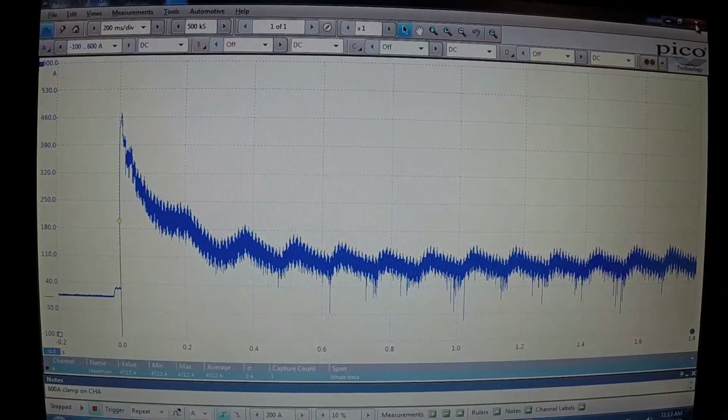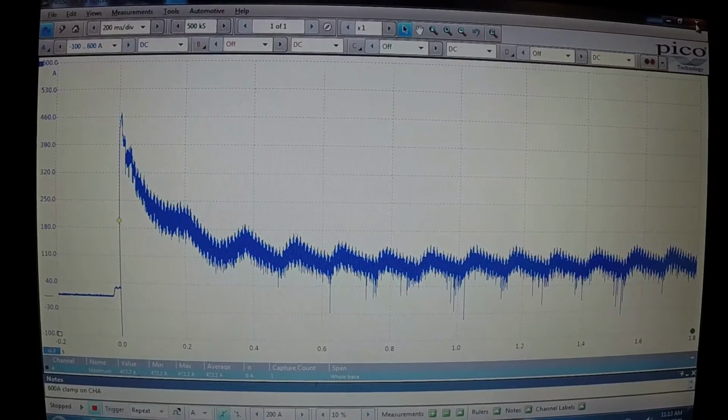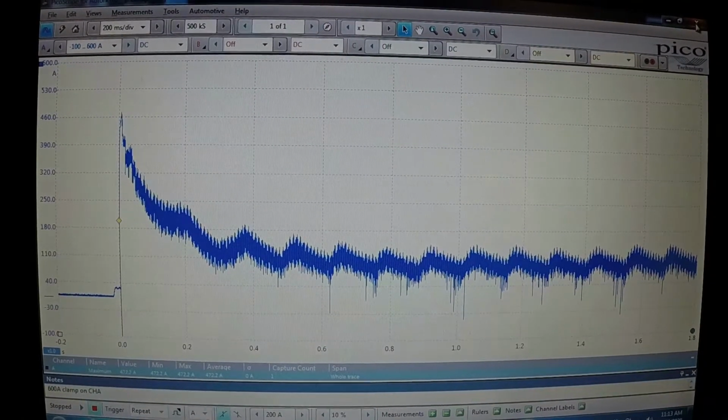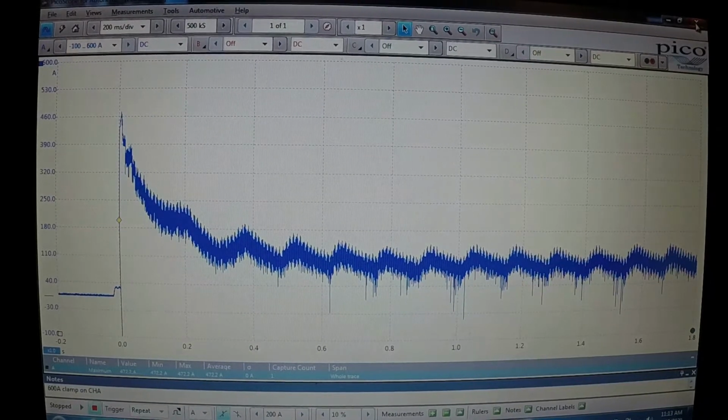This also will not pick up an electrical issue. So if you have a bad spark plug wire or coil, this test will still say you've got good compression. All this is doing is eliminating the mechanical side. You do the compression test in order to determine whether or not you've got ring problems, valve problems, piston problems, things like that. And so that's why you would do this test.